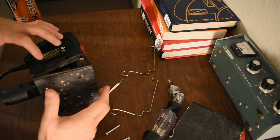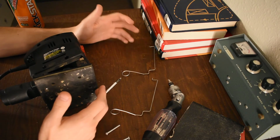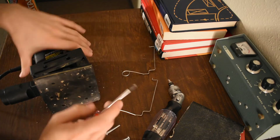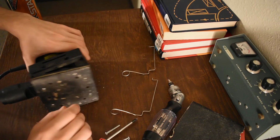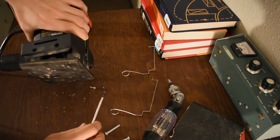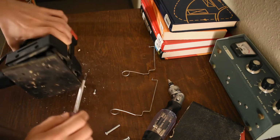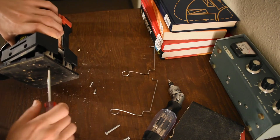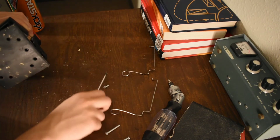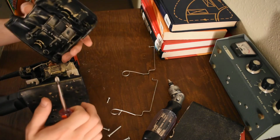That's a huge part of the price, actually. Like, the plastic is super cheap. You're paying to pay off the injection molding machines, and then you're paying for the damage you're doing to the mold when they inject it. So a lot of what you pay for when you buy these molded plastic parts is in the metal, in some far-flung Chinese factory.